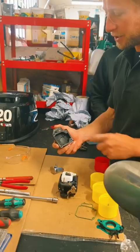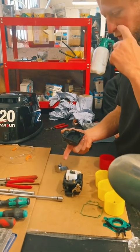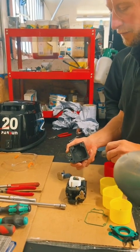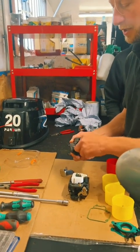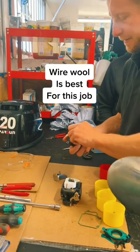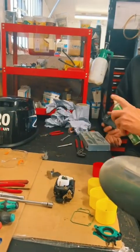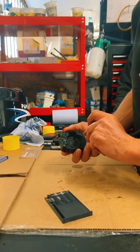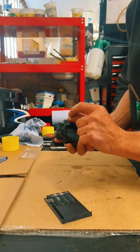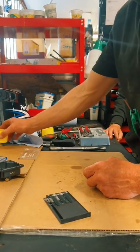And then air. You need to manually clean out the float bowl, and usually the float and the emulsion tube turret, because a lot of time if you've got a dirty carburettor, then you've got quite a lot of muck and stale fuel in there. So clean it all out. Manually. Same with the float. Then carb clean. And the final thing to test with this engine is the accelerator pump. This dumps a little bit of fuel down when you accelerate quickly. That's working nicely. Okay, I've got nothing left in there, so let's start rebuilding.